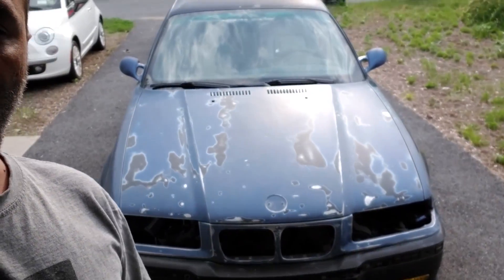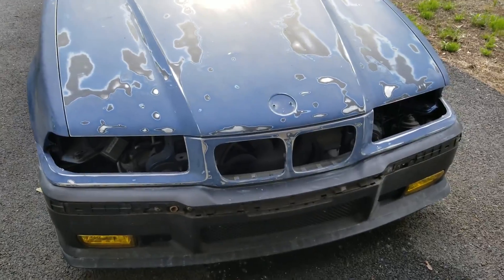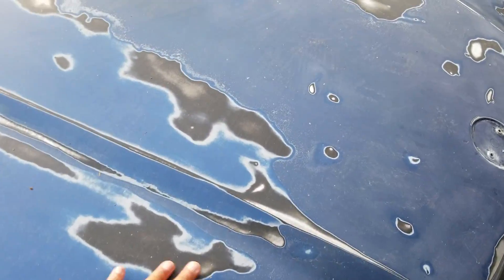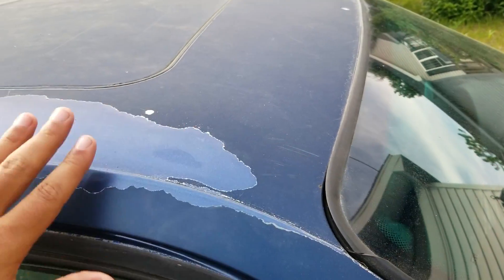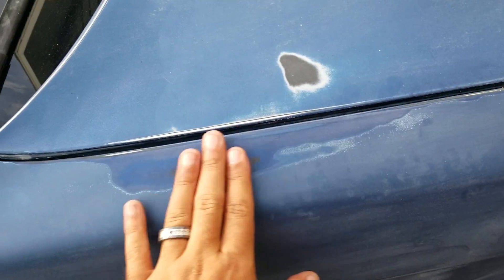As you can see right here, my M3 is in pieces. If you've been following my Instagram you know the car is being taken apart. Let's take a look at the car — this is the E36 M3, it looks radically different from previous videos because I've been sanding it. You're probably wondering why I need to sand it if I'm just going to wrap it. It's because the clear coat is so thick that you'd be able to see the contour through the wrap. The wrap guys confirmed that, so I'm sanding it down to make it nice and smooth.